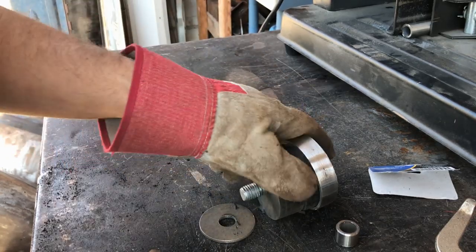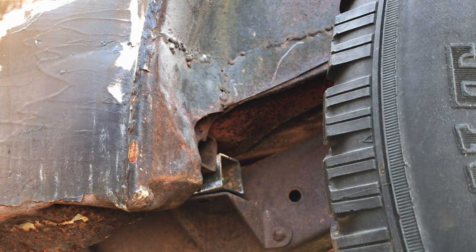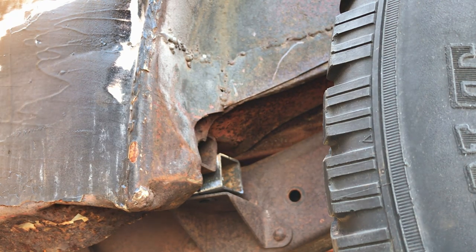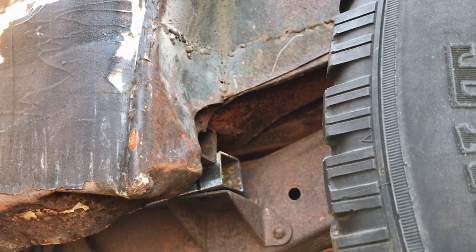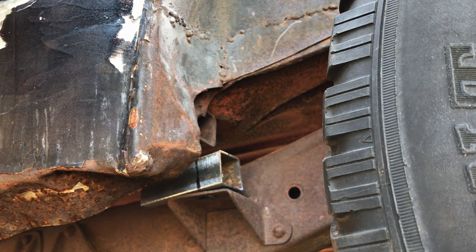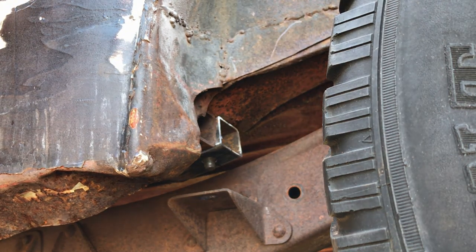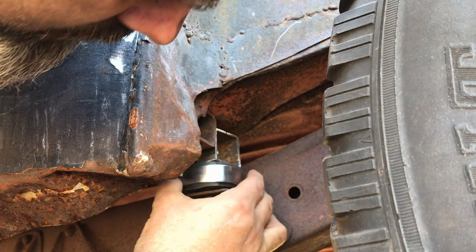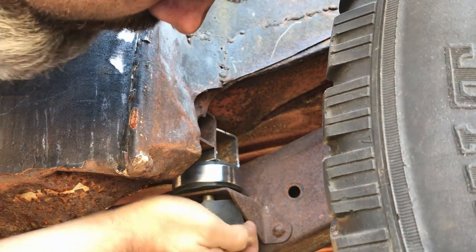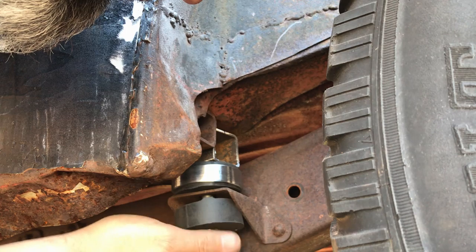I've still not welded that other section onto the car yet, but let's make sure this fits first. So as usual, I don't have the right size bolts, but I can give it a shot and then I'll know what size of bolts to go and buy. So I'll jack up the body. That should be enough. Put the bolt in through there. Put in the mount there. Goes through there. Ah, right, I'm gonna have to chop that a little bit round there. But regardless, if I lower the body down, then that should sit where it's supposed to sit.